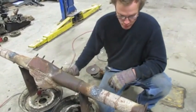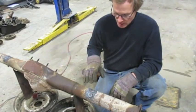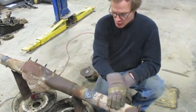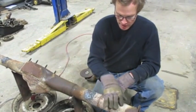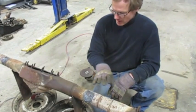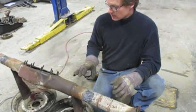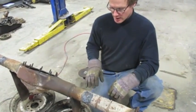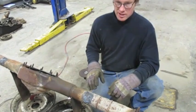The most tedious job is to grind all these smooth. Use a big angle grinder and go slow and careful, grinding it all down flush with the tubes. You don't want to grind any divots in the tubes — just nice and smooth and flush. Then after that, we can wash this housing down to get rid of all the grinding steel, mud, dust, and grease, and prepare for the next step.